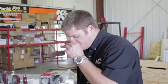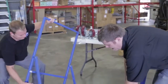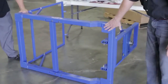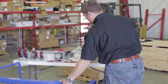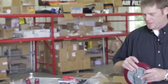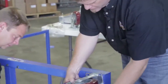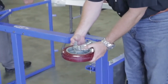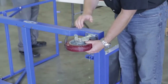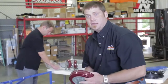We're going to flip this up on its side so we can put the casters on — it does help to have a friend because this is a heavy-duty stand. Now that we've got it on its side, the two stationary casters go on the back. One thing to keep in mind: don't put the casters on in a way that blocks access to the brakes — make sure the braking system is on the outside. Lock the two stationary ones on the back and the two pivoting ones on the front.